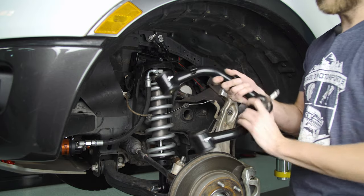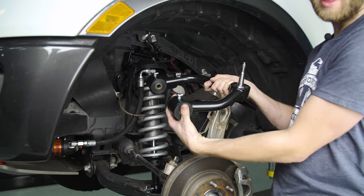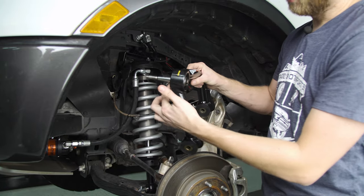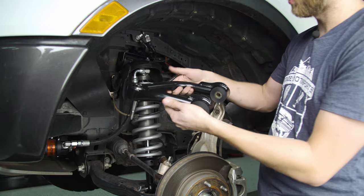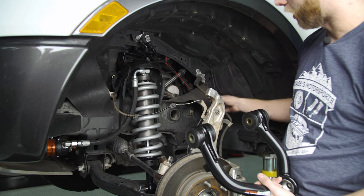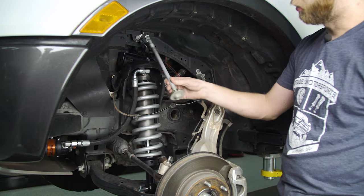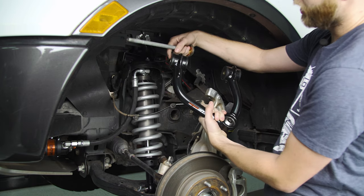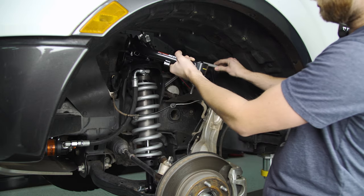Here's our new Grim Tubular arm. Before you pop this in the vehicle you'll have a little bit of assembly to do. You're going to need to grease up the bushings on the back — there are two little rubber sleeves plus the metal sleeve that goes through the center. Press that all together; you can use a vice or something like that to pound it in. Then add your two grease fittings. Up here for the uniball, pop that tapered stud in as well as the cap with the new bolt, tighten that down, and it pulls together to make a full uniball. Once the arm is set, you'll need to get this massive bolt threaded back through. On the bolt there's a big fat fender washer — you'll have two in your kit that need to go on the outside of the upper control arm bushings, with one on each side, to keep everything spaced out properly with no slack.